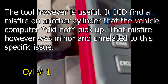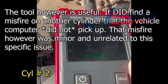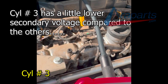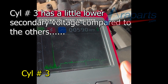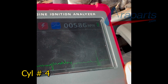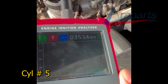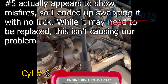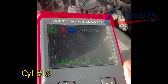I need to talk about something quick. I keep seeing people on social media lifting their ignition coils off of their spark plug while the engine is running. Doing so causes the secondary voltage to rise, risking blowing out a perfectly good ignition coil. You can get away with it for a little while, but eventually it will catch up to you — just like it did to me. I've even seen one person fry an engine control module from doing that. If you still want to diagnose them that way, it's your car, just know the risks. Just don't post videos encouraging anybody to do it that way.